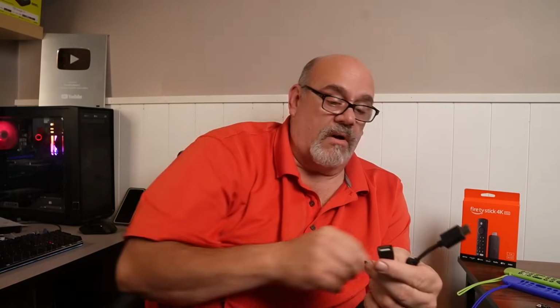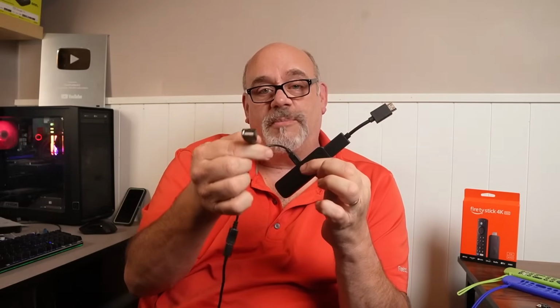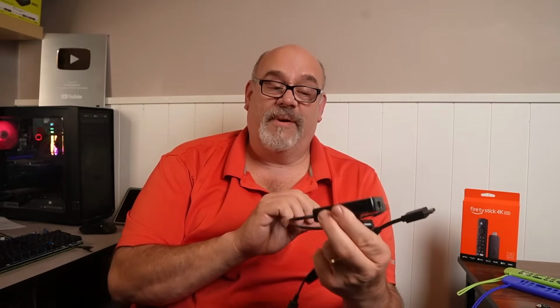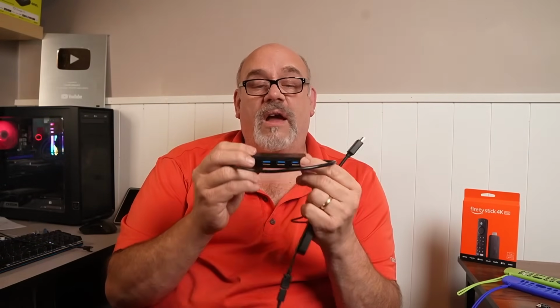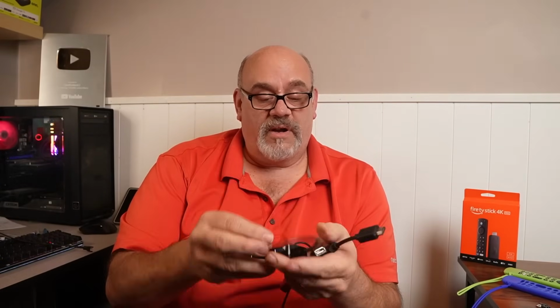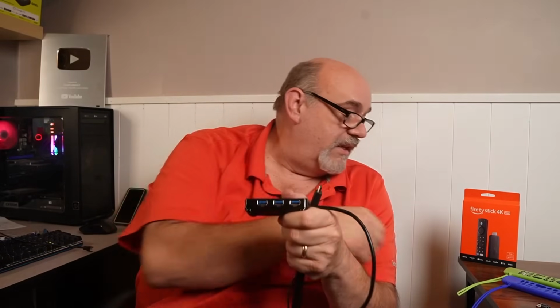You can install, if you wanted to install more than one device. As you can see here, this OTG cable only provides you with one USB-A port, right? Well, if you wanted to connect more than one, then the next accessory that a lot of people get, that is very, very popular, is this USB 3 hub with 1 gigabit Ethernet connection. And this will plug into the OTG cable as well. And then it provides you with 3 USB ports that you can plug anything into.